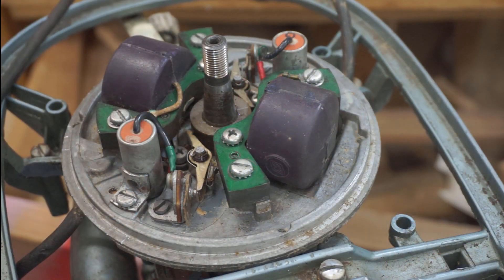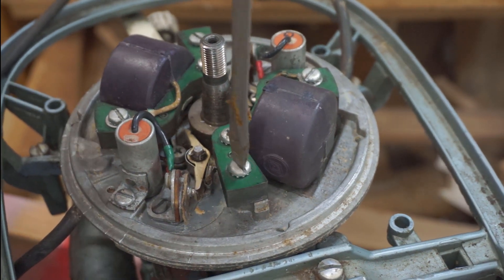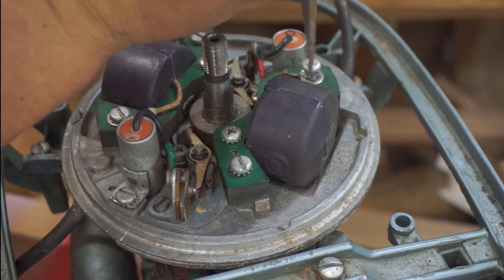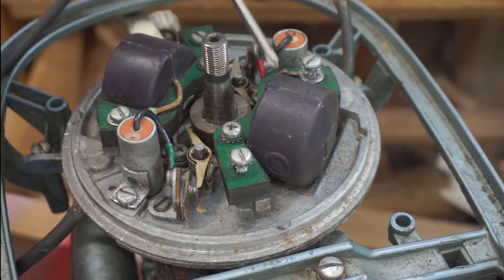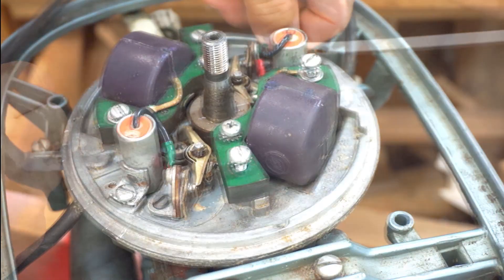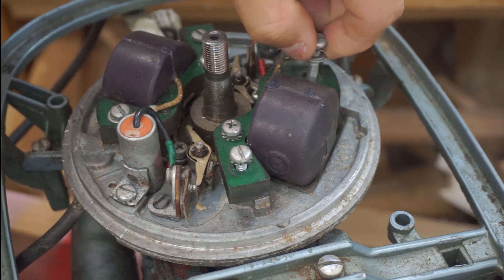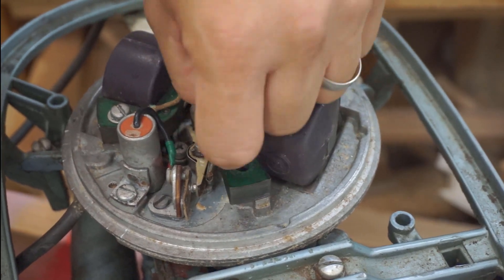Instead of just pulling the wire out and plugging the new wire into the ignition coil, I'm going to go ahead and take it out because I want to test to make sure it seats properly. There are three screws — they use both flat and Phillips, so you've got to have two screwdrivers. Where the ignition coil meets the condenser and the points, you unscrew it. Also, I like to take pictures of all this before getting started just in case. It's always a good habit — if something messes up or you don't know where it goes back, you'll know where it goes.